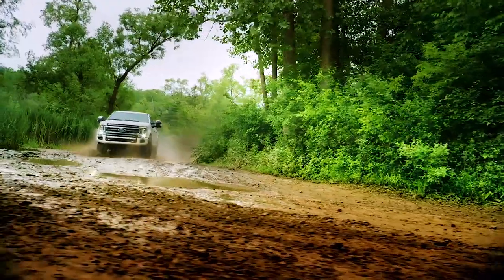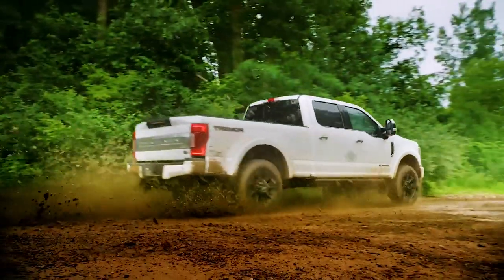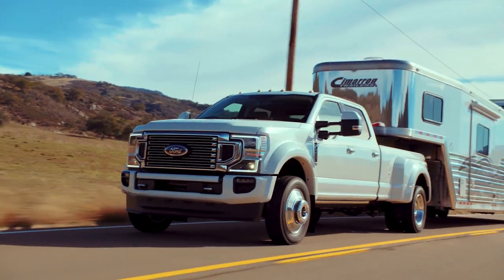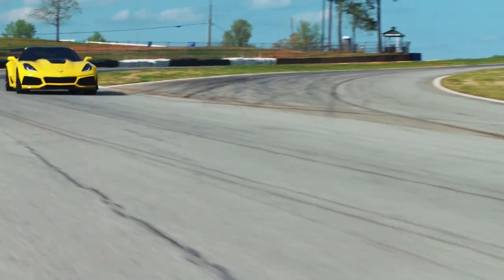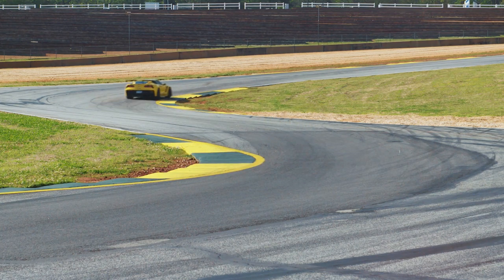The TrueTrack is a more rugged product. You're going to get about a 3.8 bias ratio, which means you multiply the torque from the low-traction wheel to the high-traction wheel by 3.8 times. It's used in rugged applications where you don't want parts that wear over time. We've been in production on medium duty trucks and in some racing applications where people want a very robust, durable, and well-proven product.